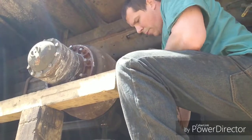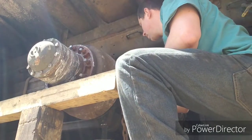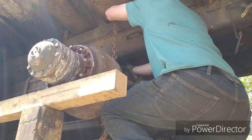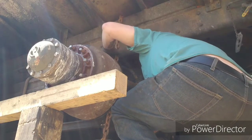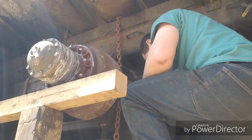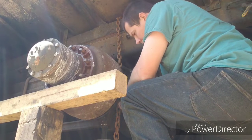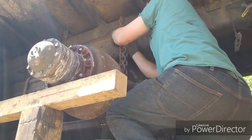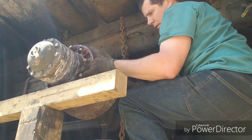When chaining, you always want to keep your slack in the middle. For the double chain method, what I normally do is go up and over the frame first, under your spring brake handle, up and over the frame — toss it over. Make sure you don't grab any brake lines or air lines. You're going to go right inside of your bump stop here, then come down and you have a bolt on the right rear side of your torque rod — that'd be the bolt for your leaf shackle. You're going to come inside of that.